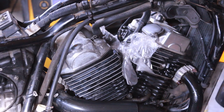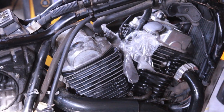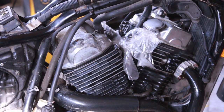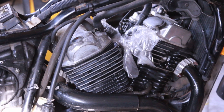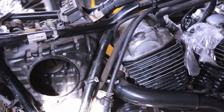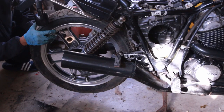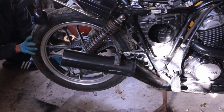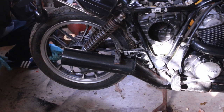One of the things I did is I removed the spark plugs and put some oil inside the spark plug tubes. I put it in the top gear on the drive and I wanted to see if the pistons were moving. This was a great suggestion by Gilbert from the YouTube channel — thanks a lot. Now I'm going to see if the wheel rotates. It's pretty tough but it will rotate. I can hear the engine and the pistons going up and down.